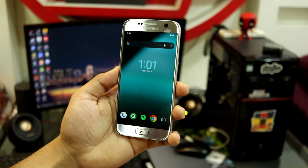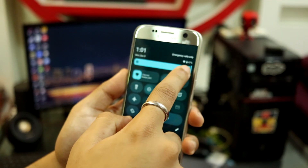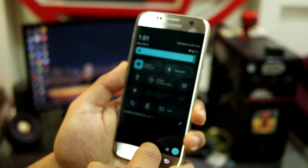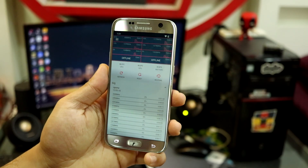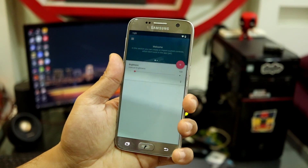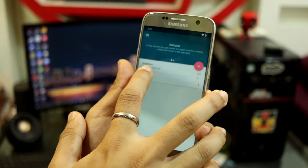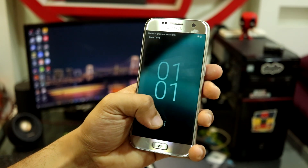Now, before the installation, I want to show you a quick fix for the brightness bug. The brightness slider from quick settings doesn't work properly — it only reaches a limited range. To fix this, you need to root your device and use the MTweaks app. Links are in the description. You need to flash Magisk from TWRP after booting. In MTweaks under Custom Controls, you have to import the JSON file — the brightness fix mod for S7.